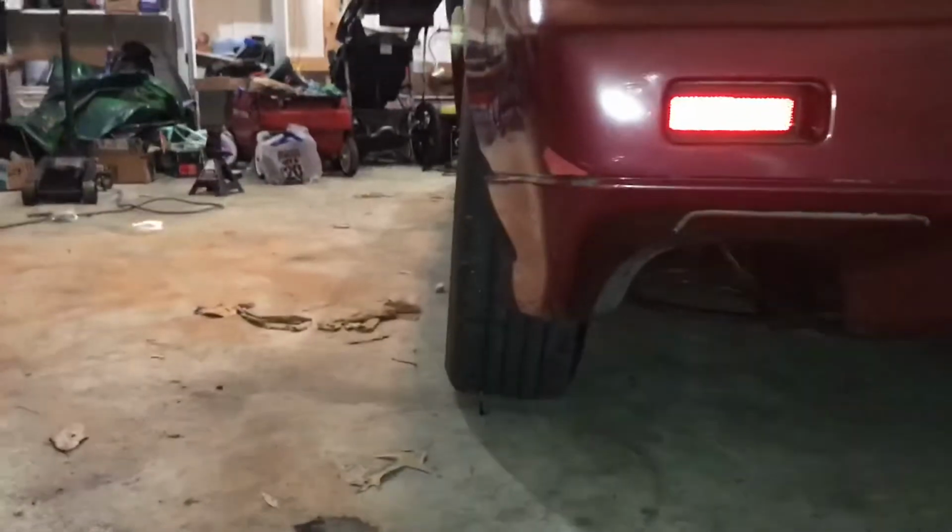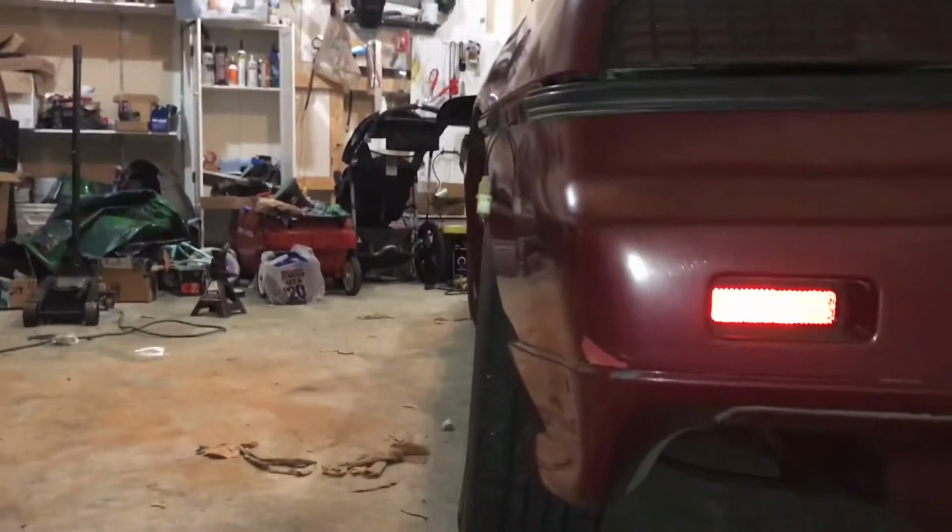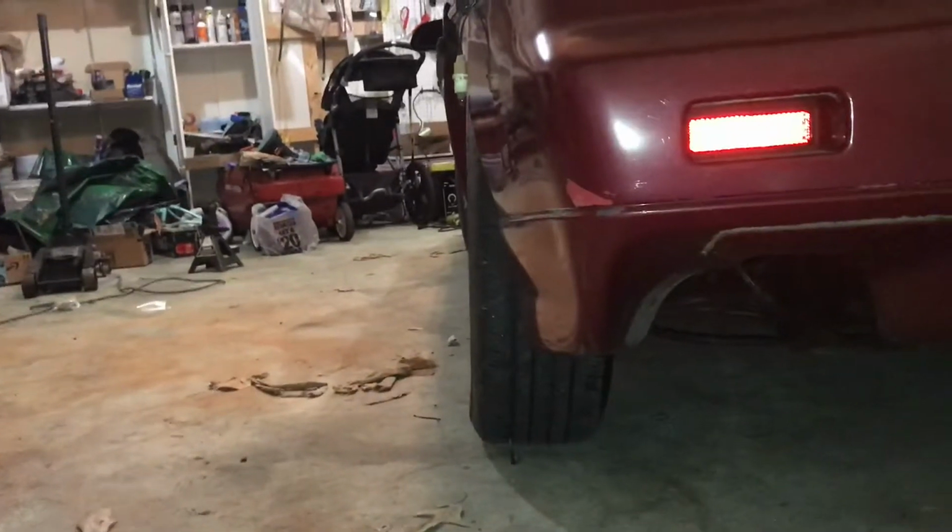I got a loose bolt on the passenger side of the vehicle. So I'm in the alignment hole. I'm going to try and bolt that down, and I'm going to try and adjust this alignment on this side. You can really see it's kicking in more than it should on a car of this age. That kind of does a good job of showing you exactly how much. I'm not all stance nation. Sorry, you can kind of tell it's a little out of alignment. You can see the little wonk right there, but it's not too bad. But one of the bolts that does the alignment on this side is sheared, so we got to get that fixed. But the biggest thing we need is antifreeze.